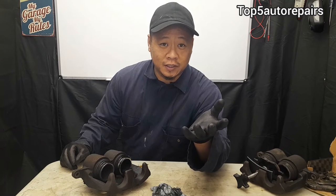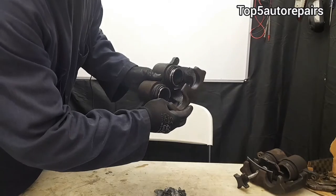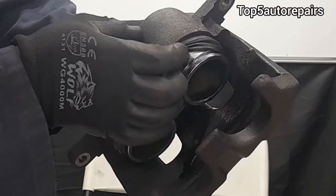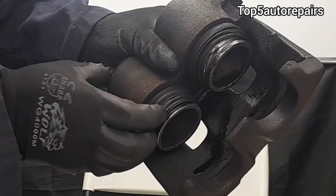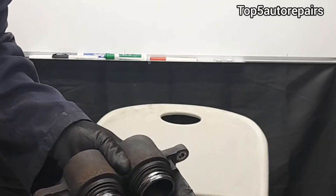The quickest way to tell if you've got a leaky brake caliper is simple — just take out your wheel and visually look at it. As you can see here, I have this brake caliper that's been leaking for a while, and it causes all sorts of buildup. If you pull back the dust boot over here, you can see that it's been leaking quite a lot of fluid. That's the quickest way to tell that you've got a leaky brake caliper.